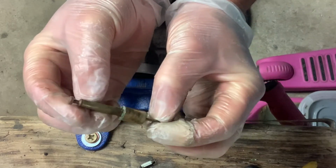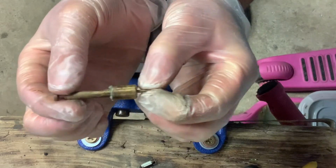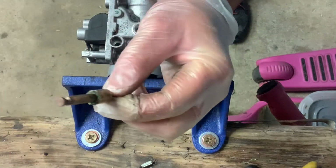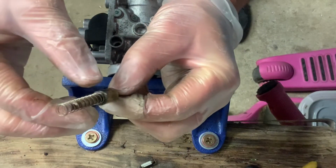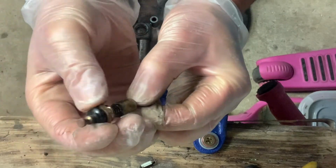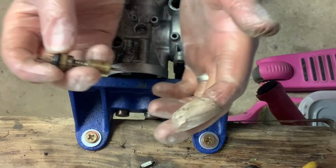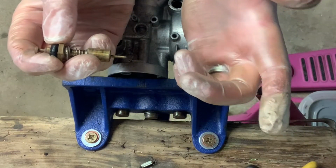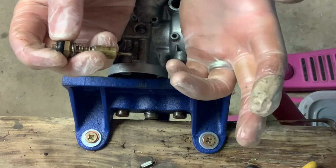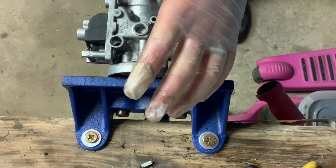Okay, so hopefully the ultrasonic cleaner should blast out some of the mess inside there. So the spring is on top, and then the cap nut lifts on there. So just rinse and repeat with all four, run it all through the ultrasonic cleaner, and jobs are good. And that's the full disassembly, well, as far as I'm going to be disassembling these carburetors.